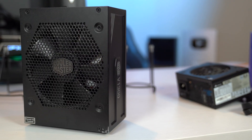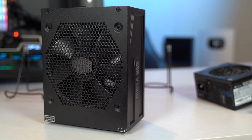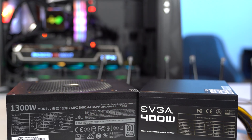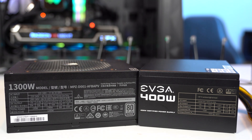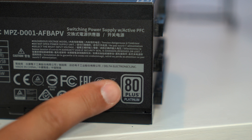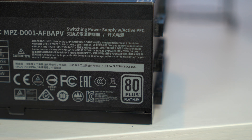And lastly, let's talk power. Power supplies are probably the least sexy part of a gaming PC, but without them you're not getting very far. As the name suggests, power supplies are what take power from the wall and bring it into the system through a series of cables routed to the various components. Power supplies come in a range of wattages from 400 up to 1,600, and efficiency ratings that are universal using what's called the 80 Plus standard. You'll see a label on most power supplies with the 80 Plus logo, and the efficiency is denoted by the color of that logo. From worst to best, you have white, bronze, silver, gold, platinum, and titanium, and as you go up, you get more efficient operation but of course higher cost.